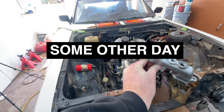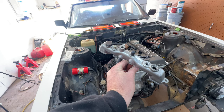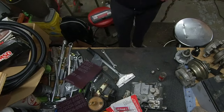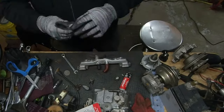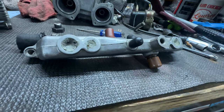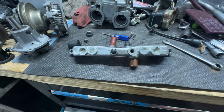I'm afraid that'll have to be all for today because I have to urinate and there is no bathroom in this shop — something I need to rectify. Moving on to the balance bar for the carburetors and filling in all those holes with JB Weld. We don't need all those holes and can't find hardware to fit them. I decided to use a two-part JB Weld system to seal up the holes — high heat epoxy, roll it up into a ball, knead it pretty good to get the activator working. I shoved it in the holes and made a little indent in each so I can fill it with a different two-part JB Weld over the top, which is more of a paste than a putty. We've got to let it sit for 24 to 48 hours and then fill it with the other stuff.